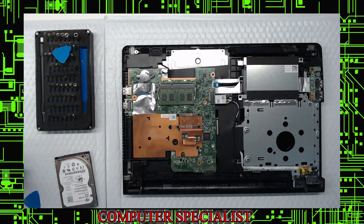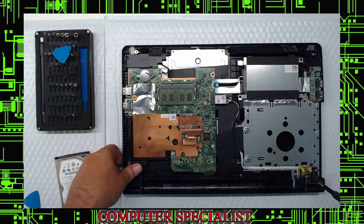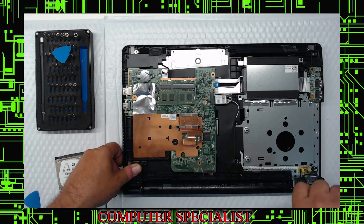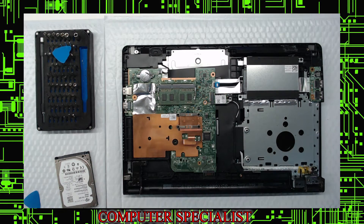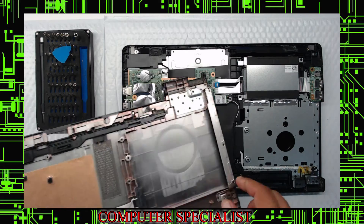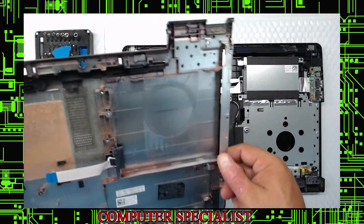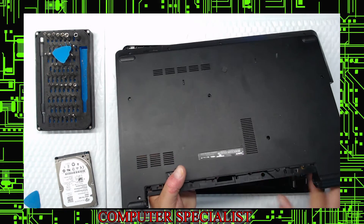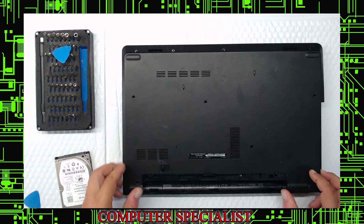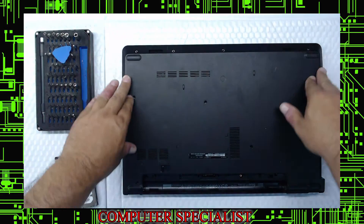The drive is in there. One thing I like to do is tighten up the hinge screws — they can take some torque and loosen up over the years. This one was a full turn loose. Now for the bottom panel — really important on this model: you have to feed this cable through here, just like it was when you took it out. Hold it up, stick it through, guide it through, lower the panel down, line it up, go around and wiggle it, then snap it down. Make sure this connector is on before you put any screws in.